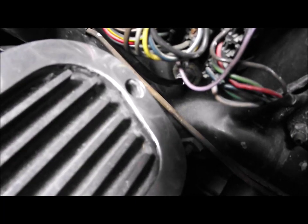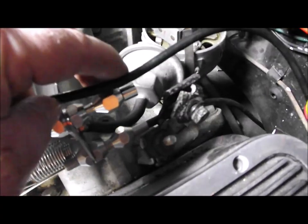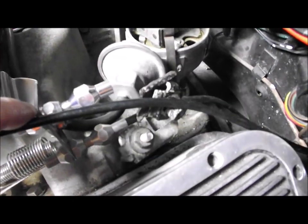the cable is coming out the bulkhead there. Now you can just see it underneath the wiring, and it's actually a good 2 inches clear of the rocker cover, whereas before it was rubbing the rocker cover. It'll come down there, cut it here, probably put some masking tape on, just try to get the position. I don't want it like that. I want to just put a little bit in it to allow for the engine to move around.